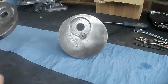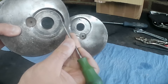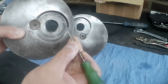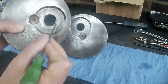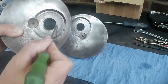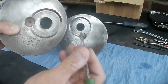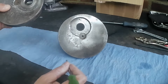We'll work with what we've got, but it is quite interesting that at 12,000 miles we're already seeing the kind of wear you see in Bantam cranks where the connecting rod is starting to wear into the face of the flywheel. The new connecting rods these days run on a different area, so you get an extra lease of life from the cranks even when they're quite badly worn in this area.